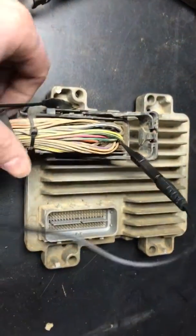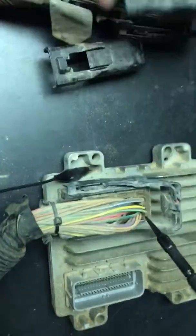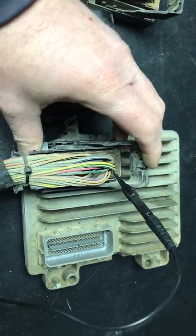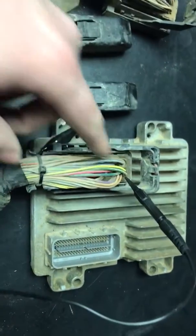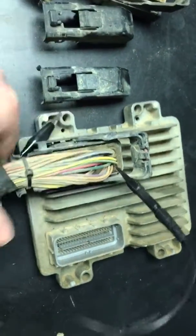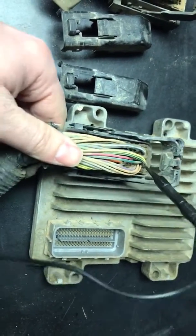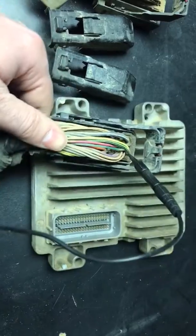For clarification: both connectors will be black — they have black caps that go on top, so you have to unplug it and pop off the cap. The test does have to be run with it connected to the computer, so you want to close and snap it back down to make sure it's latched, then back probe it with the connector latched to the computer. Pull the black cap off the black connector on the black side of the computer — that is what you're looking for. To clear up any confusion: black connector, black connector on the computer, pin 50, green white wire, check for voltage.